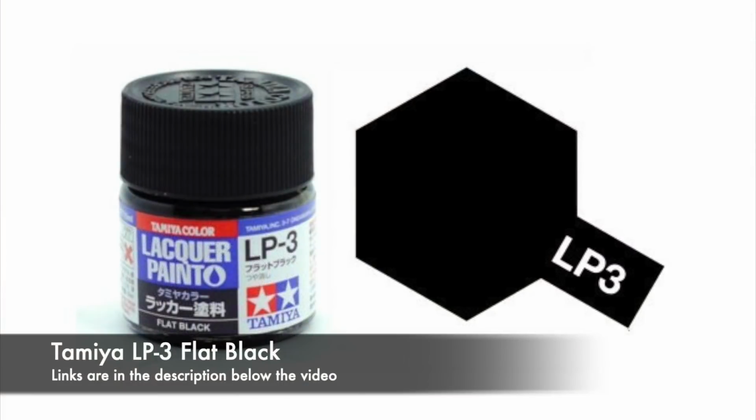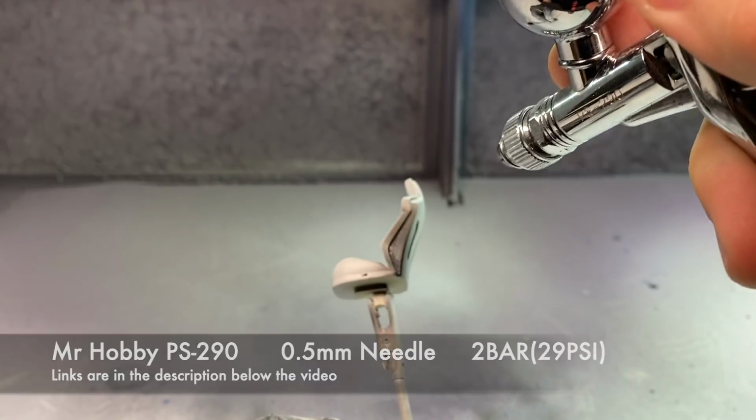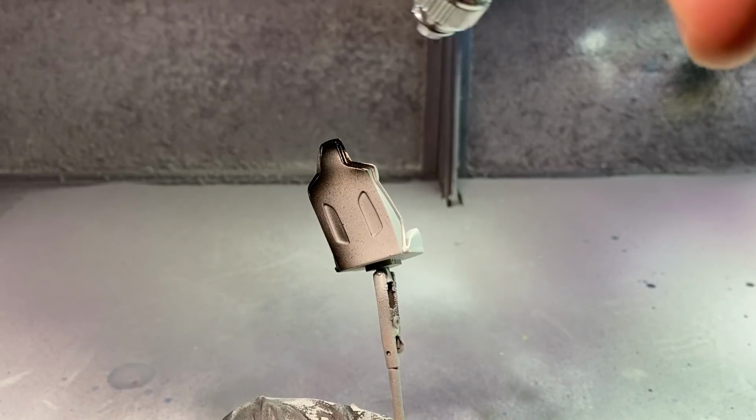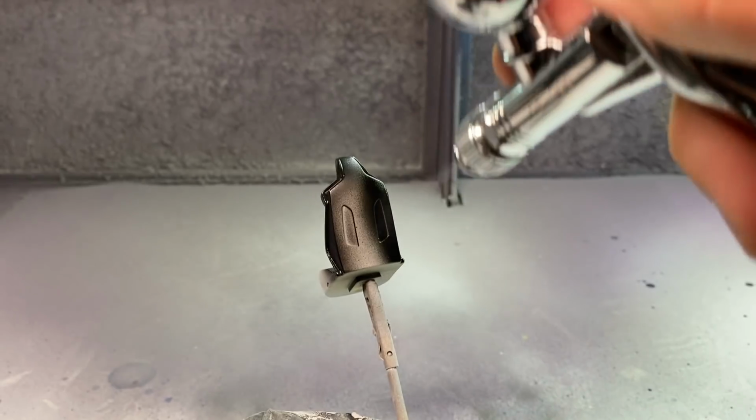With the interior going to be painted in a two-tone, some parts were painted white first and other parts were painted black first, as some of those areas were easier to mask off than the other. So the dashboard was painted white first, as that lower half was easy to paint in white and then mask off for the black. In this case, the seat backs are painted black first, as it's easier to mask these off.